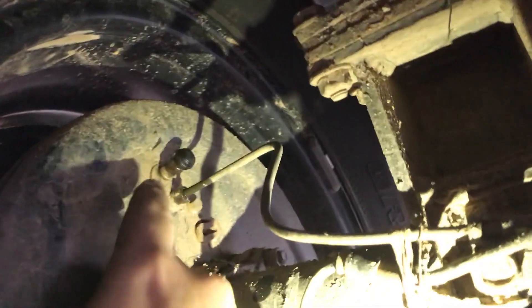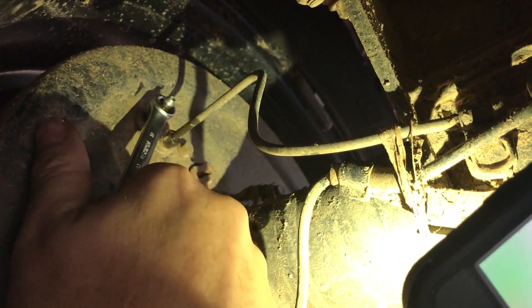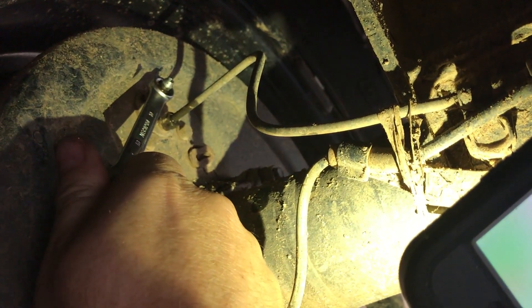So what you've got back here is this little thing. I've got to pull the grommet-y thing off, and what that's going to expose is the bleeder. So what we're going to do is put a ring spanner on it, like such, and just pop it, which is not easy to do every day.